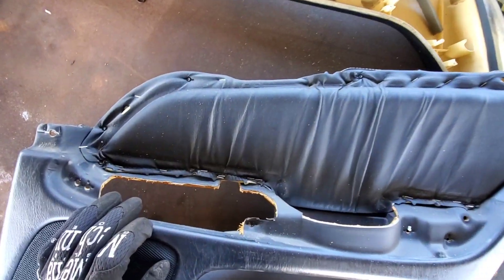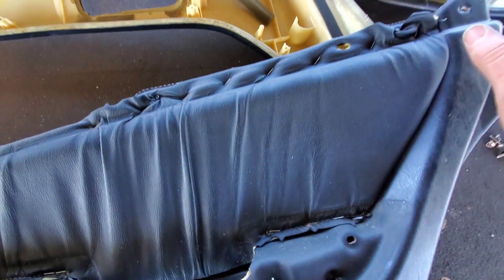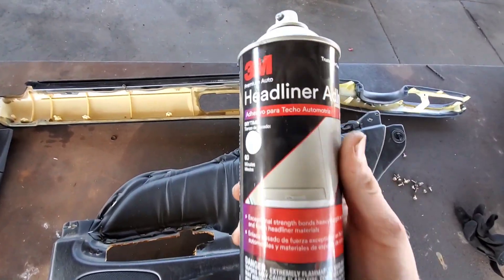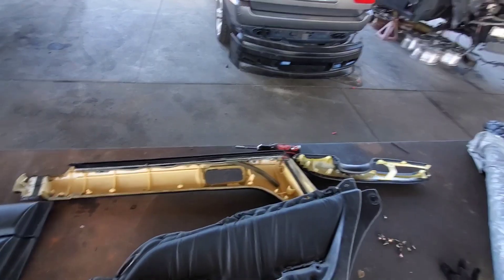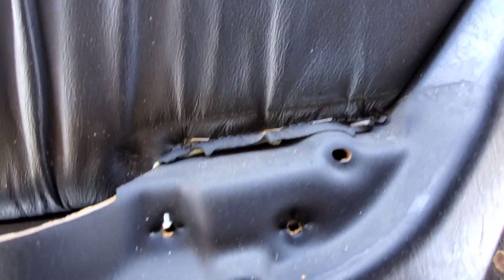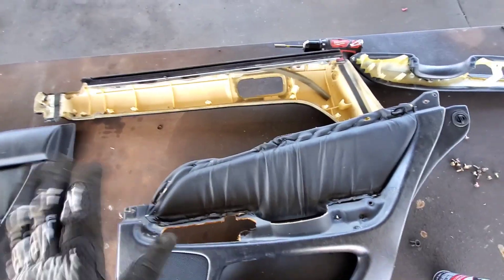And here's what you're left with. I don't know if I'm going to staple it because I don't have access to a staple gun right now — I might go out and buy one. What you're going to do is first wipe it off with wax and grease remover, because you're going to be spraying a spray adhesive on there. Here's what I'm using — a headliner adhesive. I might get some different stuff depending on how well this holds up. It says it takes 60 minutes to dry. I might end up using a staple gun just because I want it to hold up, but I know a lot of you don't have access to staple guns, so I might do one just with the headliner adhesive to see how well it holds up.